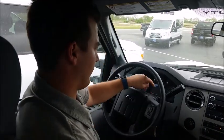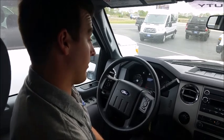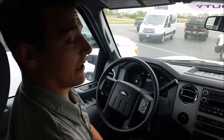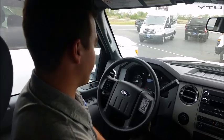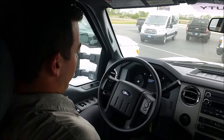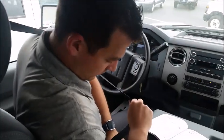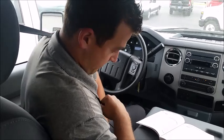After the warning light turns off — which it's still on there — I have to unbuckle the seatbelt three times at a moderate speed, and then leave it unbuckled until the light comes back on. So let's see if I can do that here without messing up. I'm going to get my seatbelt ready to go. Oh, there it goes. So let's do one, two, three.